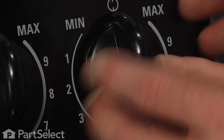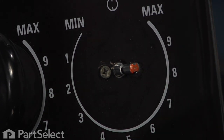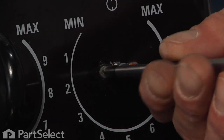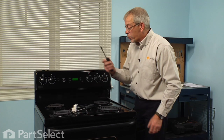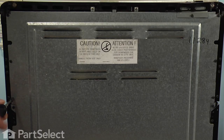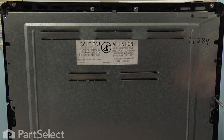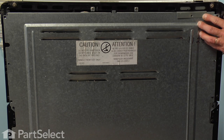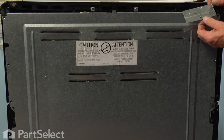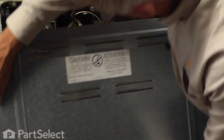The first step will be to remove the knob with a Phillips screwdriver, and remove the two Phillips screws that secure the control to the backsplash. Then with a quarter inch nut driver we'll remove six screws in the upper portion of the back panel — three along each side — and there's one remaining one on the top that goes through a little mounting bracket. Just tilt the little mounting bracket out, and now we have access to the control.